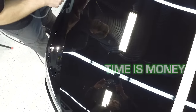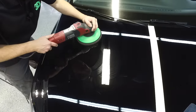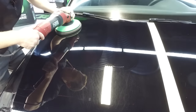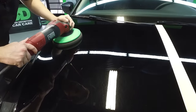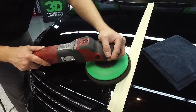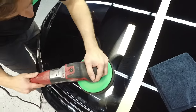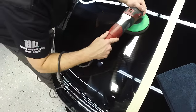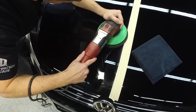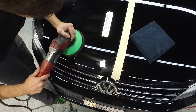As far as the weekend warrior goes, it's a great touch-up because a lot of the cars that people baby and love usually just need very light scratch removal, some towel mark removal, and create that nice quick lustrous shine. Also, the benefit is a little goes a long, long way. These are non-diminishing abrasives in here, so as long as they do not powder up and dry out, they'll continue to cut, continue to level, and create that nice beautiful high-luster shine.